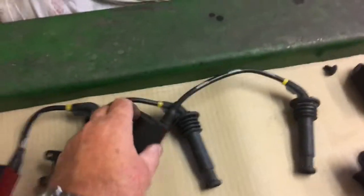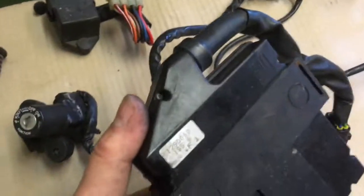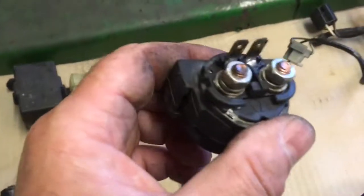Here are some of the electrical parts - obviously three coils as this is a triple cylinder machine, and those will just be put to one side. There'll be various things like this main battery wiring - put all those to one side, they might be useful later. This is the fuse box and that can be reused if you're going to reuse the original loom. The ignition switch - you're going to need that. This is the ignition module; that obviously has to be reused, and don't forget to hang on to the little bracket that mounts it - you'll need that later in the build. This is the starter solenoid - you're going to need that later. Side stand switch - you're going to want that. Flasher relay - you'll probably need that if you're reusing the original loom.